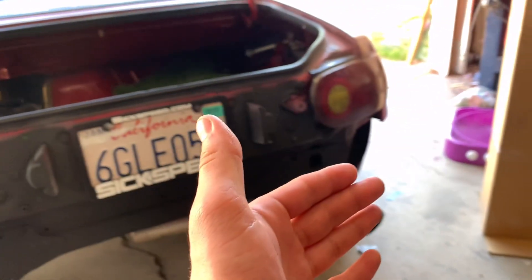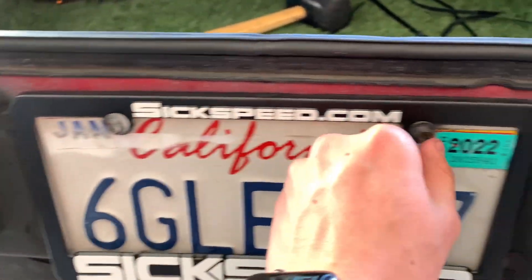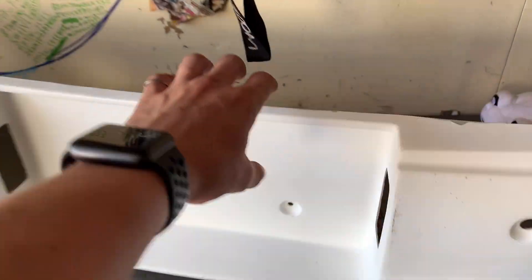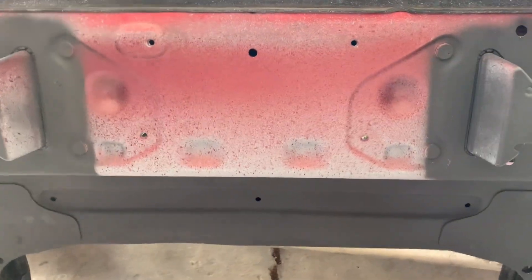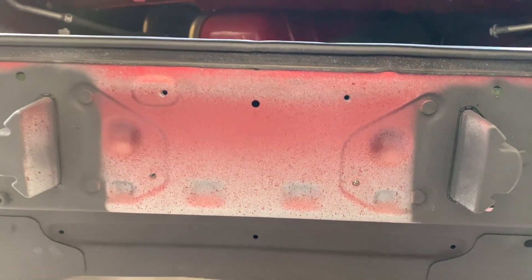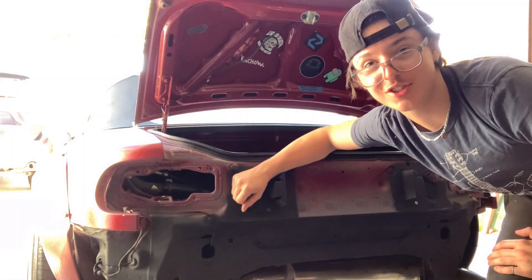Now that you understand that system, just repeat it on the other side. The last thing we're going to have to take off is the license plate — everyone knows how to take off the license plate, it's just two screws right up here, and mine are both flatheads. Take out the taillight and we're ready to put the trim on. The back of the Miata is completely stripped down. We come over and grab this trim, picking it up from the middle. The way this trim attaches is using the bottom license plate holes — where the license plate mounts up, you have two sets of holes, bottom and top. Your license plate only uses the top ones, this trim uses the bottom ones.